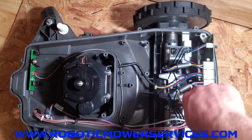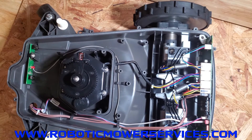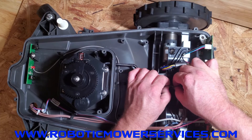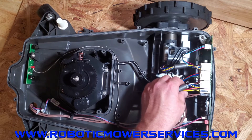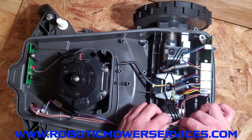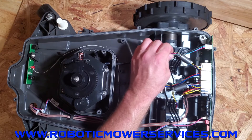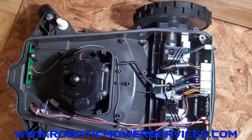Good to go with that part. Now fish your wires back down through the little clips that hold them in place — gently wiggle them down one at a time. The cutting motor wires go in their clips; the wheel motor wires sit loose under here. Over on this side you have red and blue wires for the headlights and the gray ribbon cable for your front loop sensor — wiggle them down in there. The wheel motor wire on the other side can just hang there freely, out of the way.